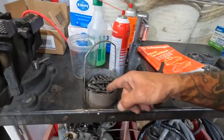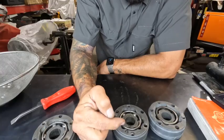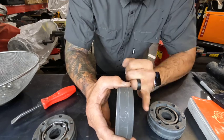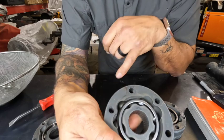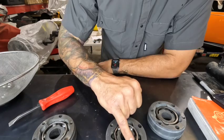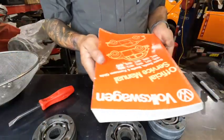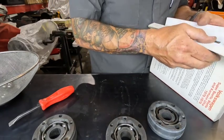That's what that silver treating is, and the bearings have been treated as well. I got my hardware cleaning up — soaked in some WD-40 to get the major funk out of it, cleaned them up in the solvent tank, and they're good to go. John made these indexing marks on here — this is what they call the cup side, which goes to the cup on the transmission or the cup on your stub axle. And this is the drive side — that inner will be chamfered, which allows for easier installation of the drive shaft to the CV joint.